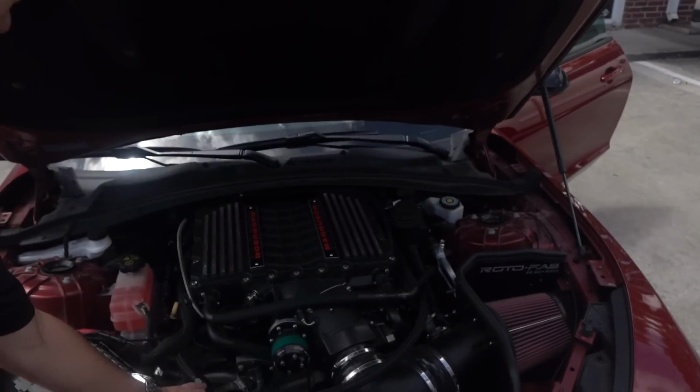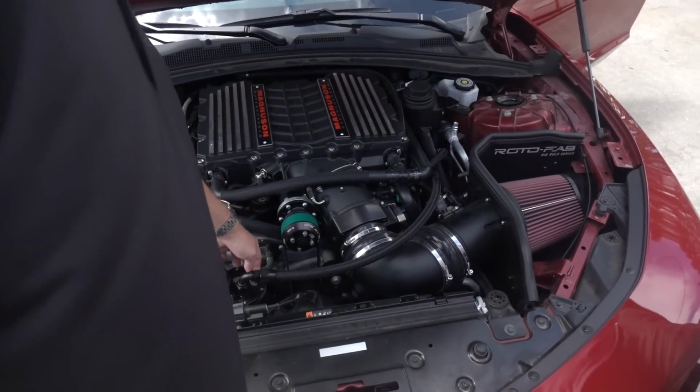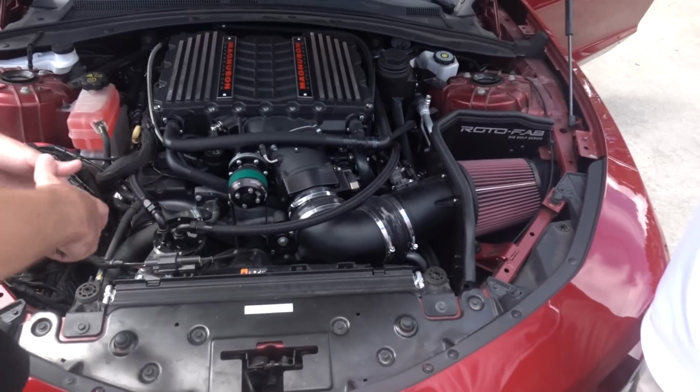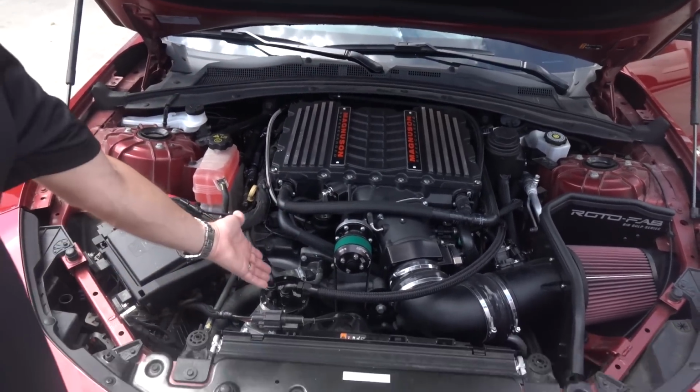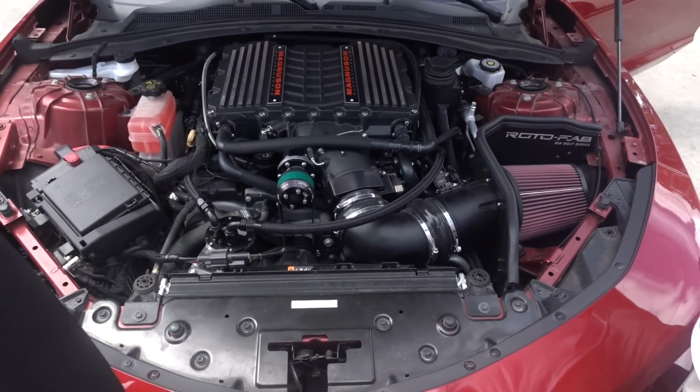I've noticed that my catch can in my truck, I've got one on my truck too, doesn't fill up that much, right? Yeah, no, it doesn't. And I've got it gapped pretty good. I'm fixing to put a turbo on it. So it's not really much about the catch can, it's more about the breathing, right? Yeah. This is just to really relieve all crankcase pressure. We're taking it from each valve cover and relieving all boost and crankcase pressure out to atmosphere. That's the main reason why we put these on. And then obviously the catch can is just a bonus on top of it.